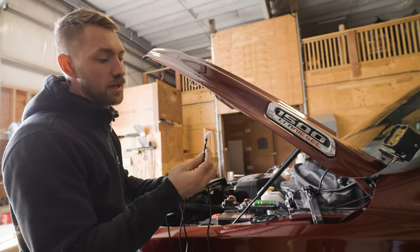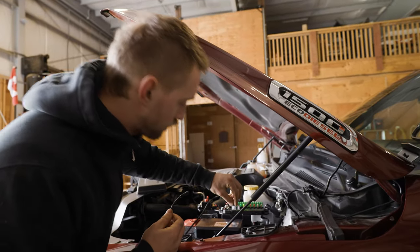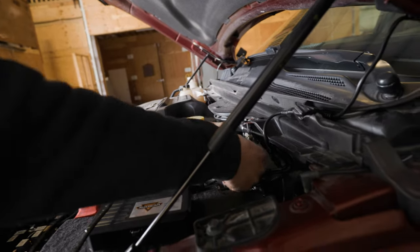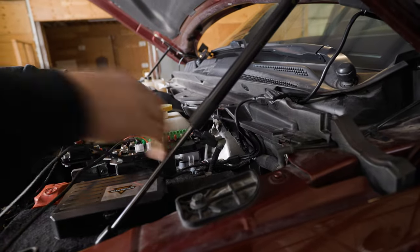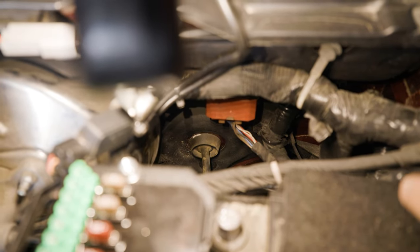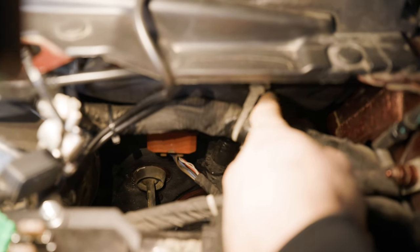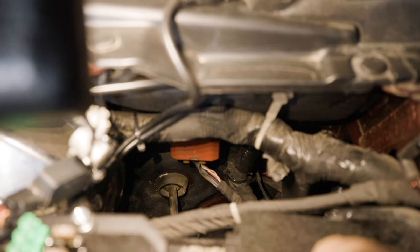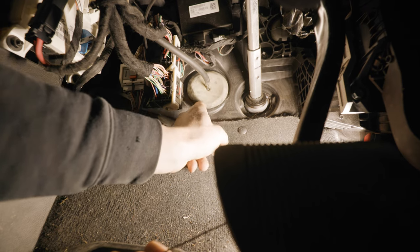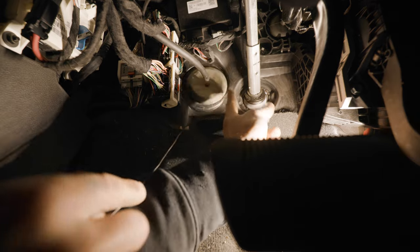Back in the engine bay, take your 4-wire aux beam harness, plug it into the switch assembly, and route the other end down through the opening in the bracket and towards the firewall. There are a couple places we can go through the firewall — where the shift lock release cable goes through is probably the easiest. There's also a place up top where you can put smaller wires through if you cut a nub off, but the controller connector is a little too big. So we're going to go into the inside of the cab, cut a small incision in there, and pass the wire through. Back in the cab underneath your pedals, this is where that cable goes through — fold the inside up and make an incision, and look into the grommet behind.